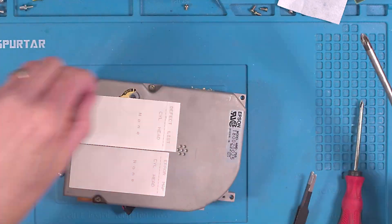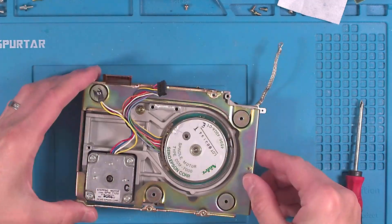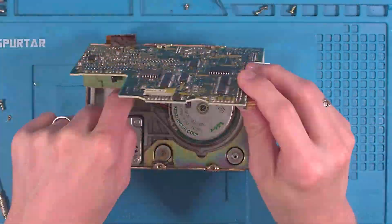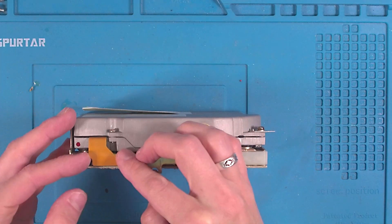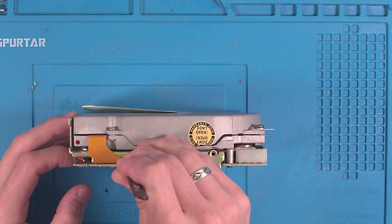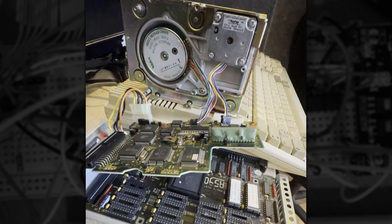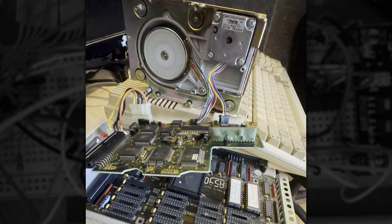So let's put it all back together again and give it a test, starting with the drive cover, the spindle sticker, the dampening supports, and finally the PCB. I'm reattaching the little flat cable on the side, which we know has something to do with the read-write heads. With the drive back together I gave it another test, but it still didn't spin up. So I took the PCB back off the back of the drive again, and if while powered up I give the motor a little head start, it gently spins up and spins properly.